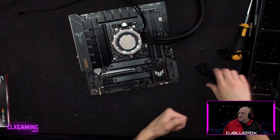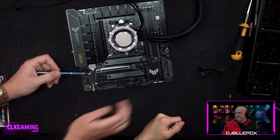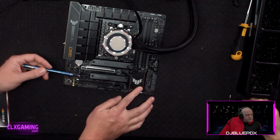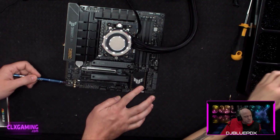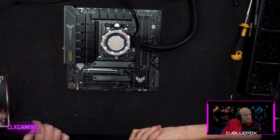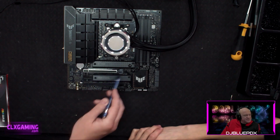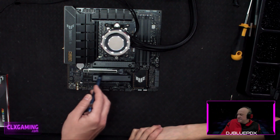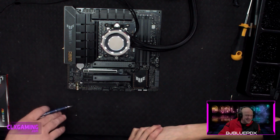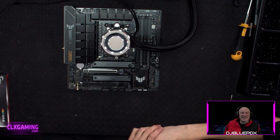Can you describe the different forms of PCI that can come on a motherboard and what the big difference is? Yeah, so if we go back to our overhead shot here, Jason, these are obviously our PCIe slots. We talked about that a lot. Those are the only slots we have on this board as far as card slots. This is PCIe x1, and this is PCIe x16, so just a little bit different length. But what he had on his was a PCI. Now that was obviously before PCIe, so it's a totally different keyed slot. You can't put a PCIe card into a PCI slot. So that was just really showing the age of the system. Nowadays you're gonna have PCIe on everything. So that was pretty wild that he had that.